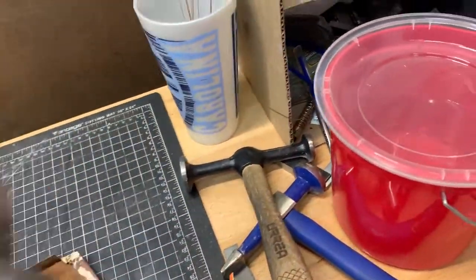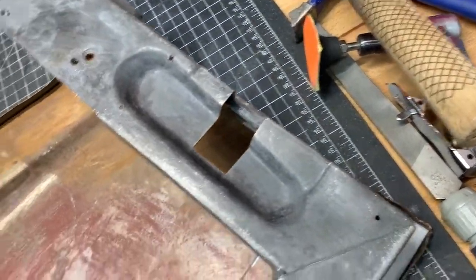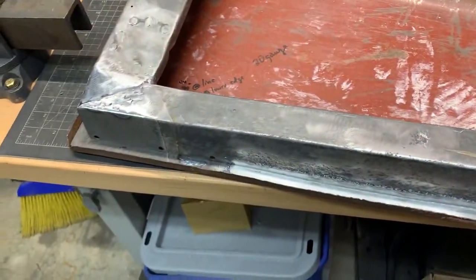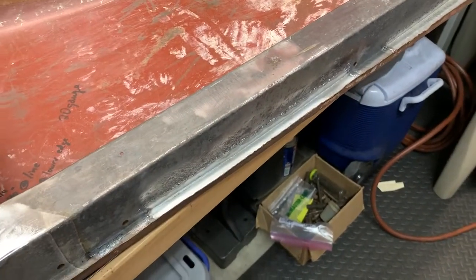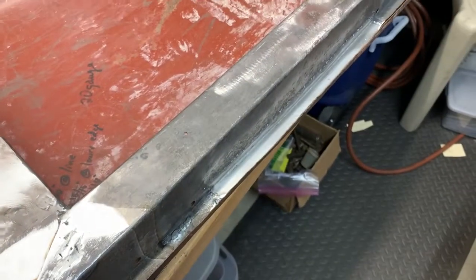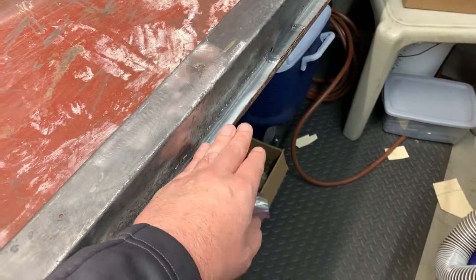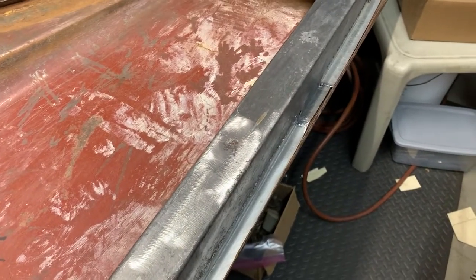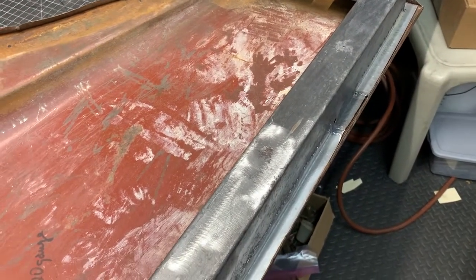I was taking this door and putting it onto the old door skin just to see how well things fit. It fits just fine — it's nice and flat. There's just a little bit too much over here on the flange, but I haven't ground that down yet. When I do, it'll all fit just fine. I'll have to figure out exactly how to get the bend of that door, because the bottom of this door really didn't go along with the flange — the flange was wavy and quite different in different places. I'll have to figure out how you turn over that door skin so it actually fits the opening very well.